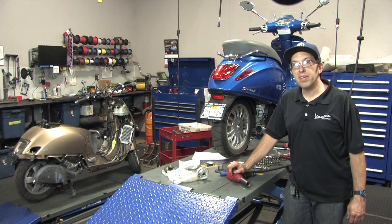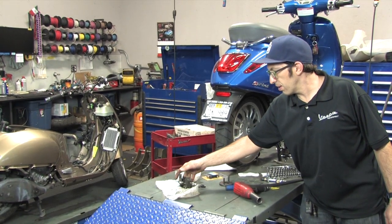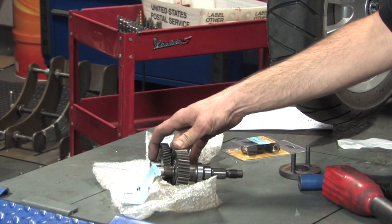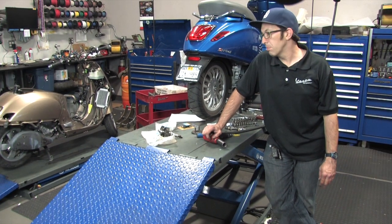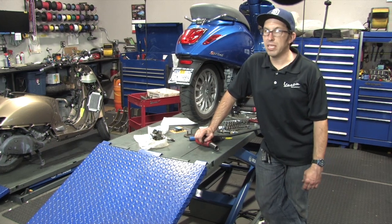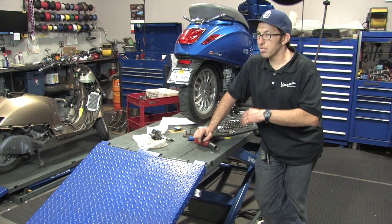It's essentially a 10% overdrive using stock parts — actually the Primavera gear set. The final gear ratio of this final driving axle is about 10% taller. It allows the scooter to sacrifice a little bit off-the-line performance, but you're going to gain a higher top speed and a better cruising speed. The engine doesn't need to stress at higher RPMs when you're cruising at higher speeds. This is completely ideal if you're doing long distance touring on this scooter.